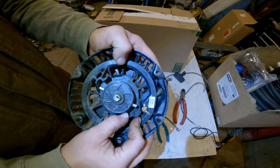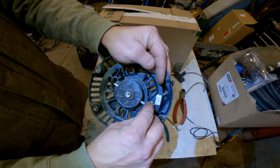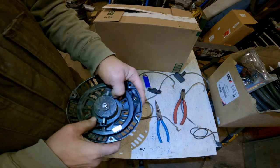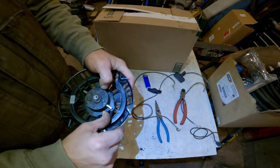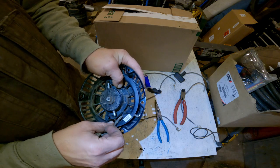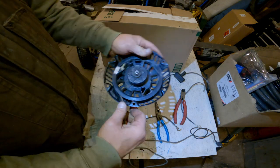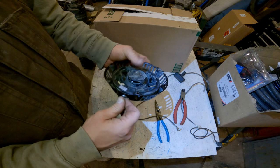If you don't know how this works — you pull this, see these two pins that stick out? That's what grabs the engine, turns it over, and when the engine starts it whips them back in. So you pull, it grabs the engine, turns it over, engine starts, those go in. What I like to do: wind it up, line up your two holes, feed your rope through, pull through the other side, get your knot to sit nicely in there, and let it go — winds right up. Now there's tension on that, pulling the handle in so it won't be flopping around.